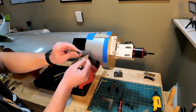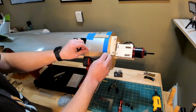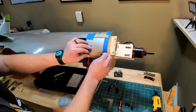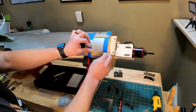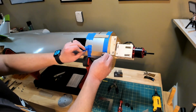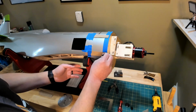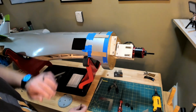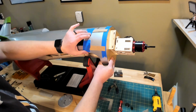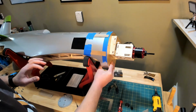So we go through the hole on the cardboard and then put the drill bit into the hole and secure the piece of cardboard with blue painter's tape. Again, that is showing us where that hole is. So when we slide the cowl over it, we will slide the cowl underneath those pieces of cardboard, and the cardboard will tell us exactly where to drill those holes.